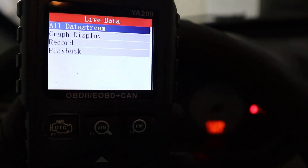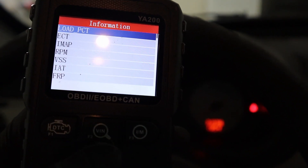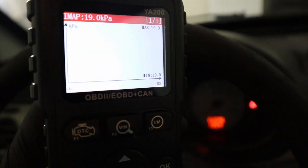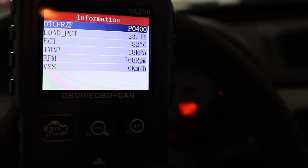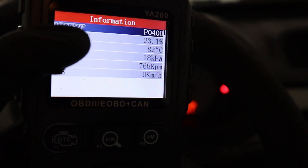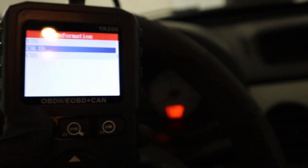Let's check if we can display data as graphs — and apparently we can. When you are trying to look at engine data to find some fault, it is much easier to look at a graph than a text value. You can select available data to display as graphs, such as MAP — pressure in your intake manifold. The car can also display freeze frame data: the P0400 code has freeze frame showing live data for the moment the code was stored in the ECU. We also have vehicle information like the VIN number and calibration ID for the engine control module.